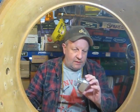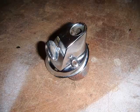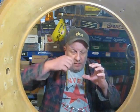The other thing I'm considering as well, this has been drilled for the 298 folding spurs, the later ones, and I've always been a fan of the disappearing spurs. Now, I know not a lot of people like those and they have difficulty with them, but I quite like them. I quite like the retro look. So I'm thinking of using the 1297 version of the Premier disappearing spurs. Now, they're not the ones with the lever spring, they're the ones that actually put a wing bolt on them, and I could get some new spurs, probably even 10.5mm, because I think I've got some of the later mounts with a bigger hole. So I'll have a look at that.